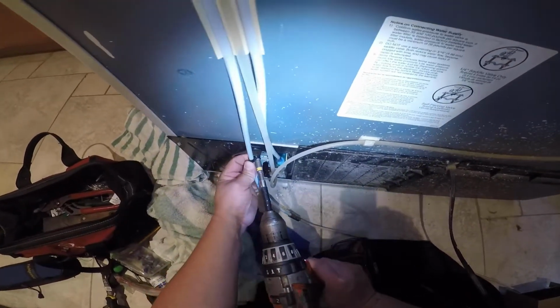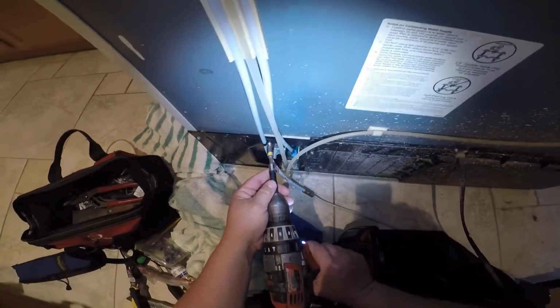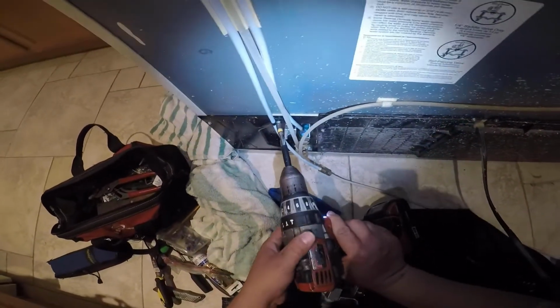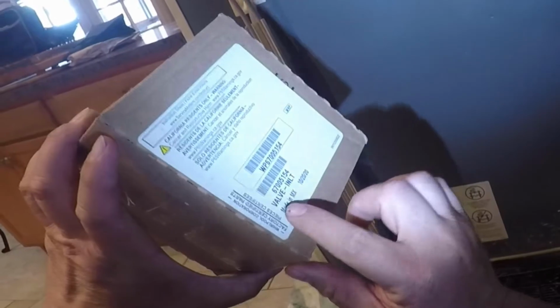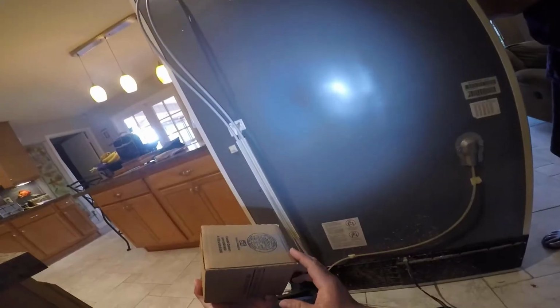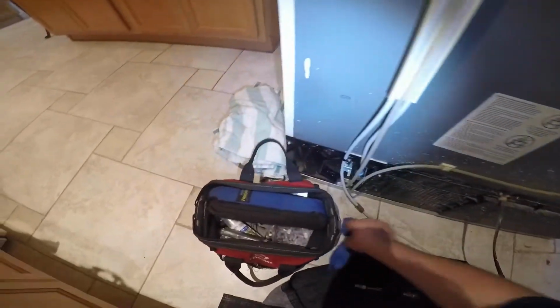And the other thing that you have to do before you replace this water valve is go ahead and replace the filter, because sometimes you can have a clogged filter if you're not getting any water or ice. Oh, by the way, this is the part number. I just focused it there for you, and you can get this part and the link in the description of this video.